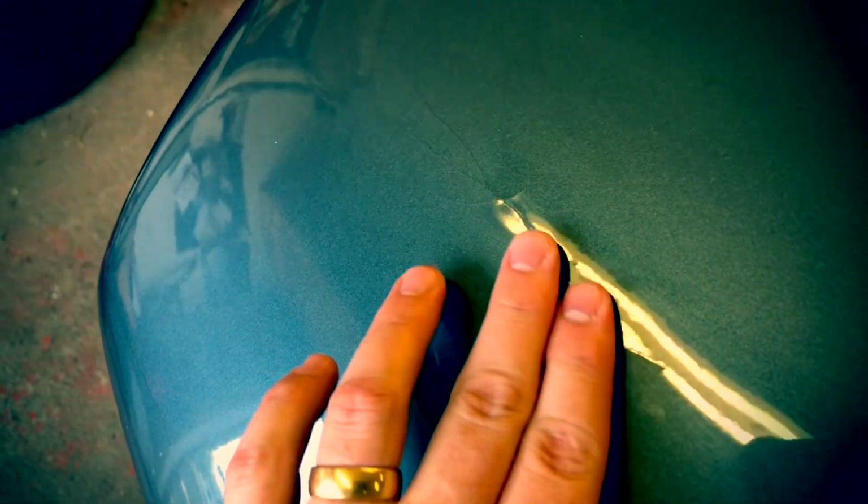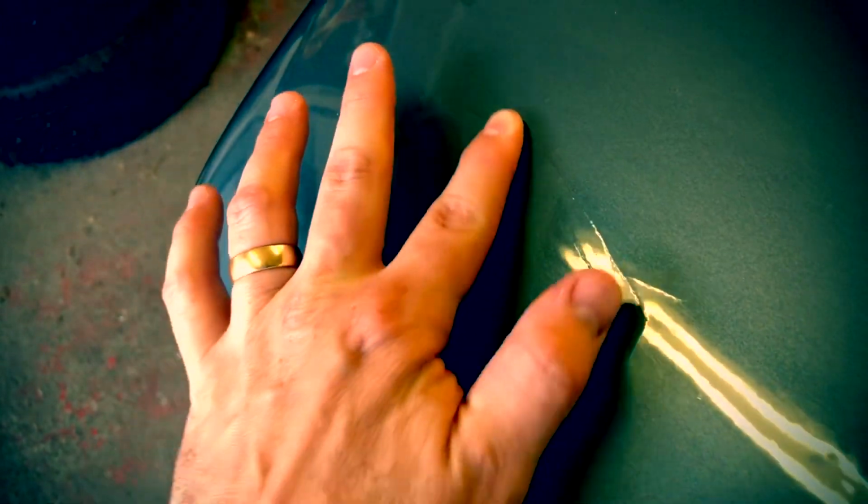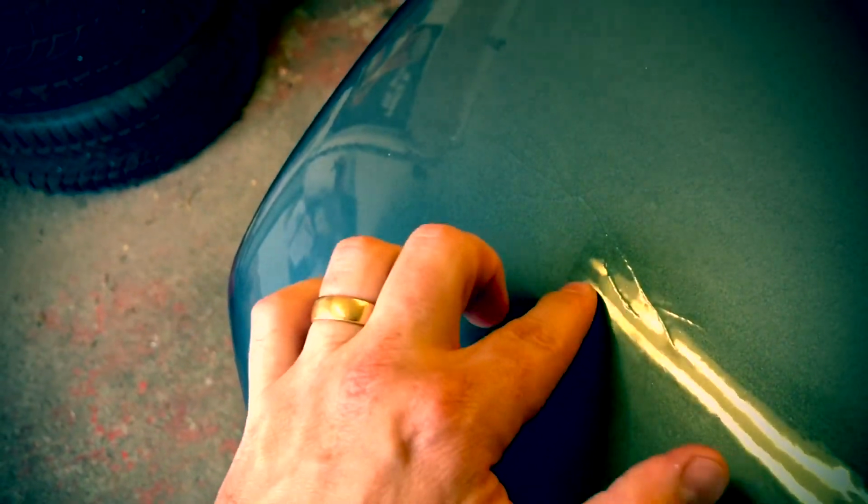Also, I discovered that it actually has some cracks going on here. You can barely see them, like hairline fractures, but that implies that this second paintwork from the previous owner isn't sustaining the test of time when it comes to heat and general punishment of weather. But I'm not gonna address that other than just putting on clear coat, because it's gonna hide it. I can feel just a little one here, but all in all it's pretty smooth. I don't feel any warp and it doesn't show anything, so I'm just going with the clear coat,